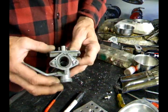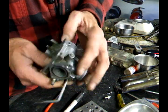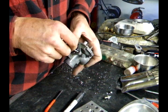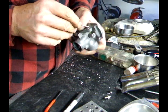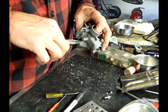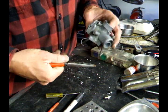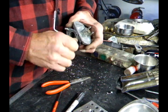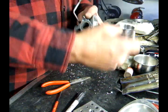Now that I have the thread in there, you can see the new thread. There's a little drive tang that has to get knocked out, so I'll just take a small screwdriver and bust it out. Now I can grab it with the pliers and break it off. And there — I can just screw the new stud in there and tighten it up with a wrench.